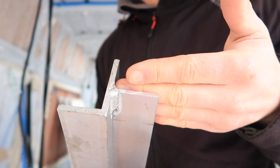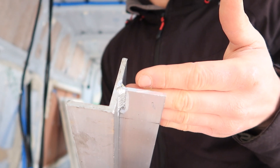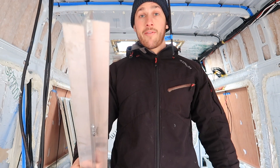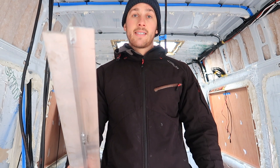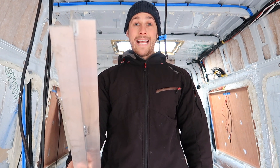I'll show you at the end of the video how I'm going to fix the solar panels — this is my own idea after watching a few videos, and I'll have to test it on the road to see whether it's rattle-proof and secure. Now I'm going to get the angle brackets sat on the roof, mark them through the holes I knocked out in the ceiling, then fix them down with M8 bolts, washers, and nylock nuts.